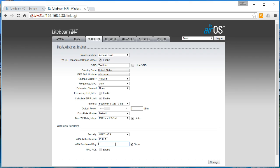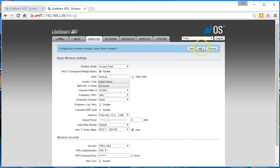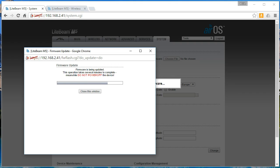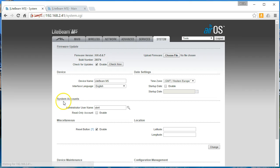For Security, we'll turn on WPA2 with pre-shared key, and we'll just say the passphrase is 'letmein1!' — and now we are going to hit Change and Apply. The settings are going to take effect. So you saw me check the box for WDS transparent bridge — this is for a point-to-point connection.